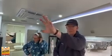Now, let's say you haven't got gas. You'll see the E1. You will waste a bit of water, obviously. But what you'd like to do is just head outside and turn on your gas tanks, and then away you go. Now, if this thing is playing up, you just go outside and flick off that switch I showed you. Wait for a few seconds, switch it back on, and that will reset it. And it will work okay.